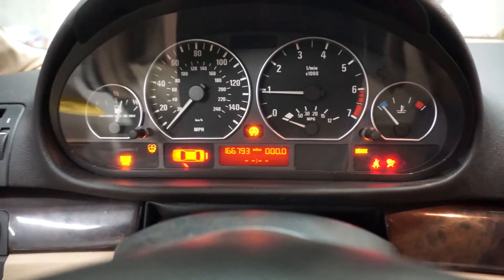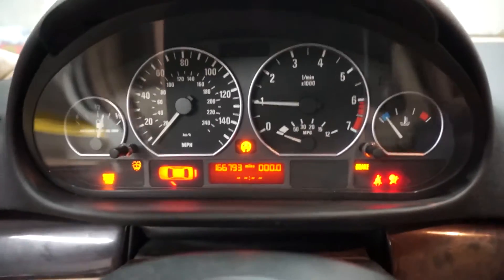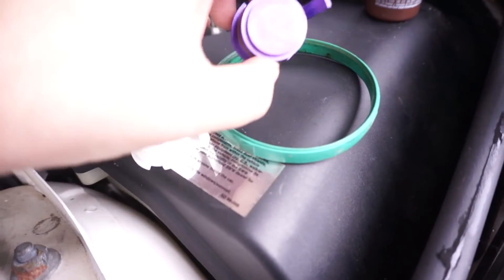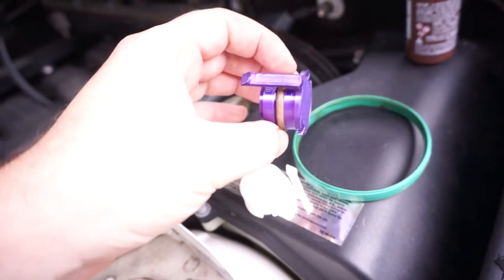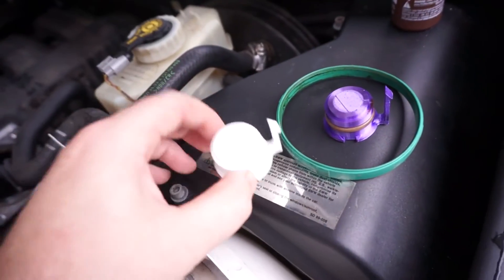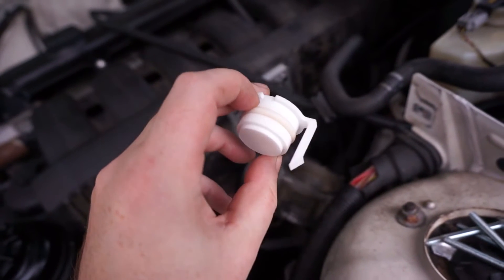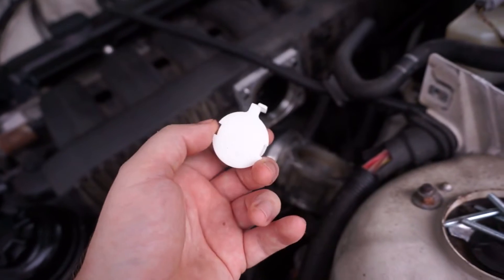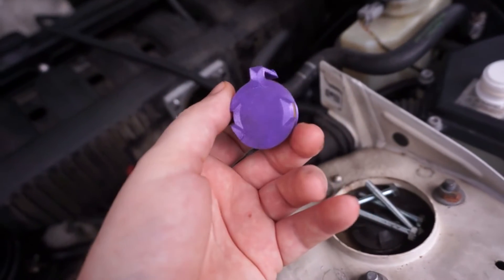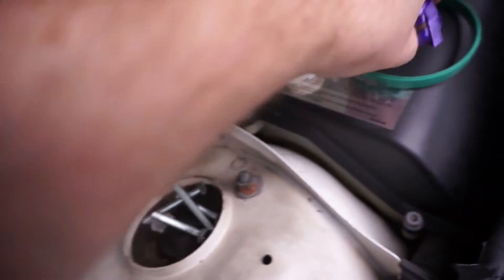The water pump makes weird noises on this car, but that's actually really good and I don't have good data on these injectors, so I'm happy with that. I'm replacing the intake gaskets for the throttle body and also replacing this 3D printed piece — this one is PLA and it's not rated for oil contamination or temperature. What I did is order this one, which is SLS — I think it's PA12 — so this one is a much, much stronger piece and will hold up to the temperatures and chemicals found in the engine bay. That said, this one's been in here for over a month. I've driven the car maybe 10 miles and it's actually perfectly fine — I'm quite surprised.